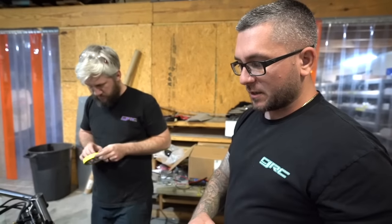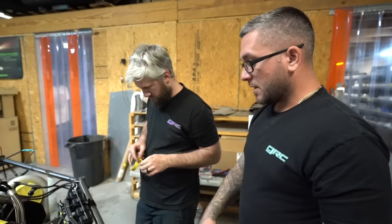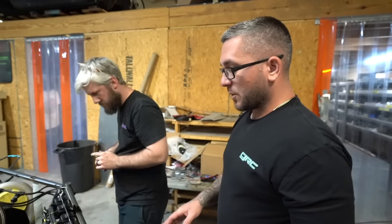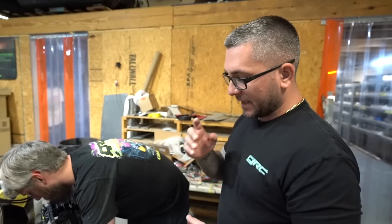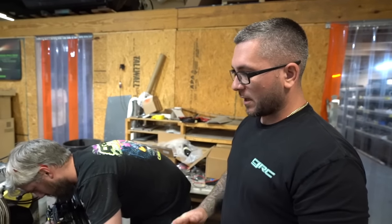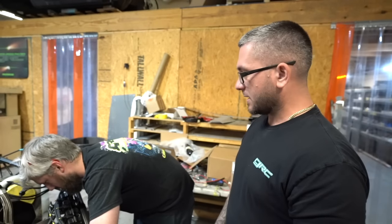We just got this machine. We switched from Fragola to Brown & Miller. Actually, this is the first car we've crimped with it, so hopefully it works out okay. But their line is super nice. Proline went to a braided style line like this on most of their cars, I think because they had an issue, possibly someone had an issue with a Pro Mod and a fire, maybe, burning through the regular black braided stuff.